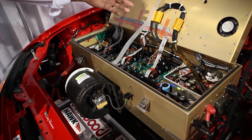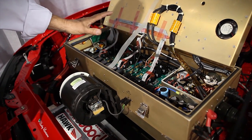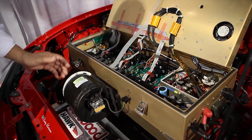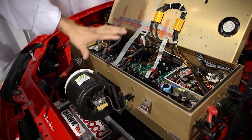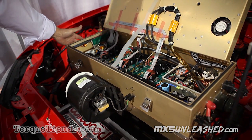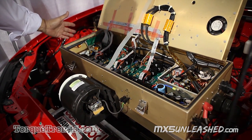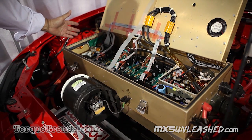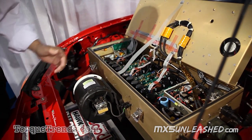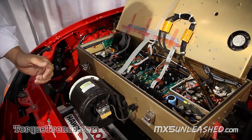It actually incorporates the AC motor in the charging process. A unique feature of this AC Propulsion package is that we can take our 22 kilowatt hours of storage and simply plug in to charge another electric car from this package. Or we can actually power our house — we've done our house or office for several days. In a blackout or something like that, you've got 22 kilowatt hours of storage just sitting there on four wheels.